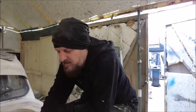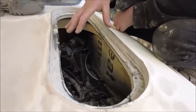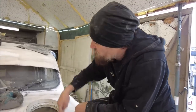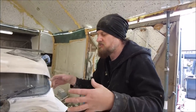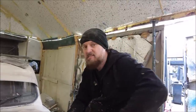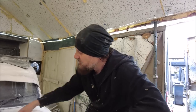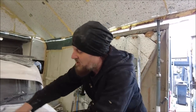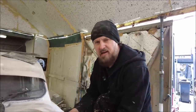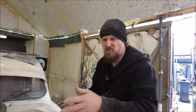So I've cut that centre out and I've got this rebate, which I planned on putting the glass in, but like I said, I need to make this flush. So I'm going to get rid of that rebate, I'm going to re-line this, so that when you look through, the bonnet looks like it's thick — well it is, it's made of fiberglass and a lot of filler, but quality thickness. So I'm going to cut that out and then close in here, make all this nice, ready for that top bit that's somehow going to hold the glass. It'll come to me — let's just cut this out.